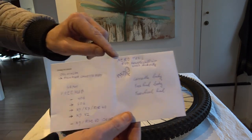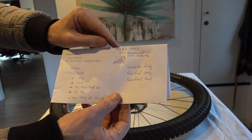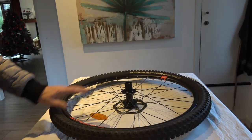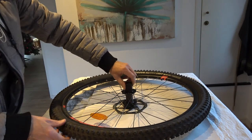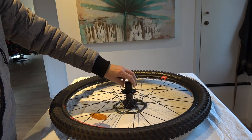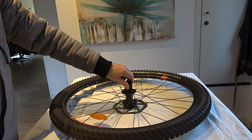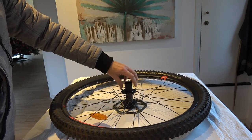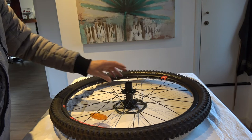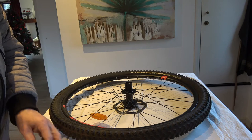The right part corresponds to my wheel: the EVO double wall rim 6063 disc only. This freewheel hub — by the way, there are several names for it: sometimes it's called the cassette body, sometimes the freehub body, also called the freehub. All these terms are used. And at Decathlon they bought the wrong one, and on top of that they didn't know how to remove it.